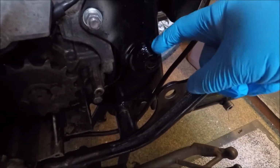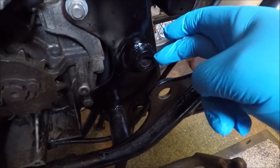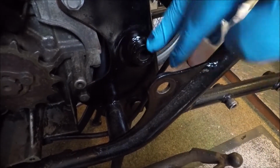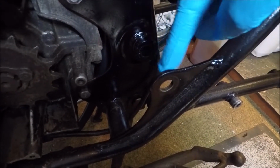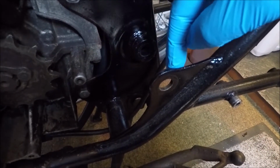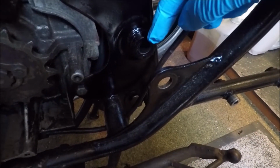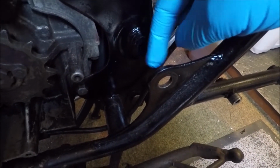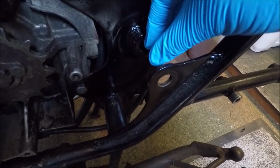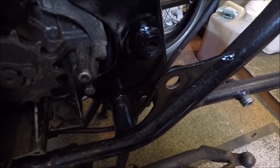So this is the lug. It's a bit poor lighting to see, but there's the lug that that completely rubber one hooks around. So we've got to get the side of the swing arm between this plate and that, with the rubber one on that and the plate up against that one and on the other side. So if there's an issue with those bushes, the gap between this face and the other one on the side will mean that the bushes are too tight, and it'll be a right pain to get on to there. But we'll see how we go.